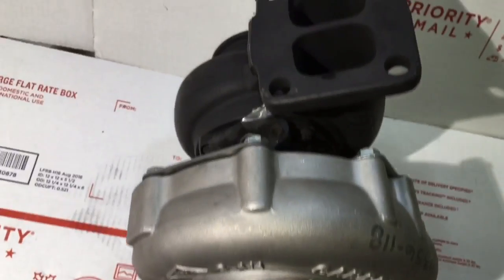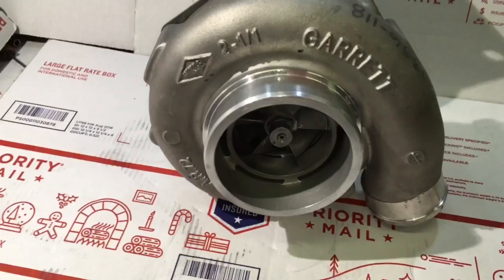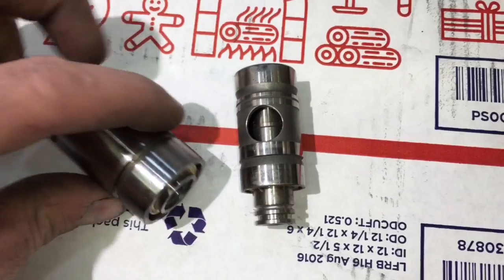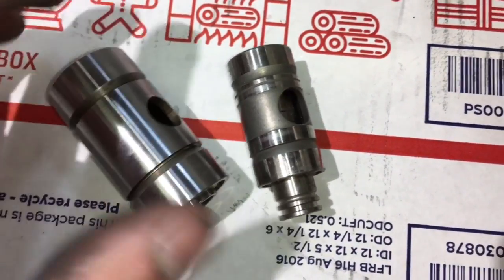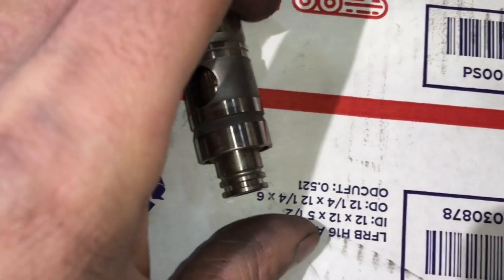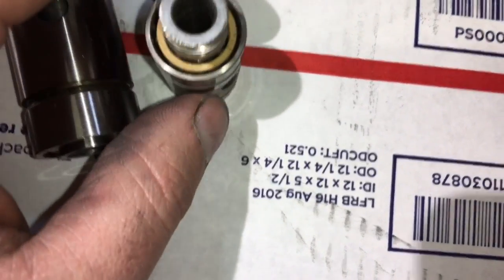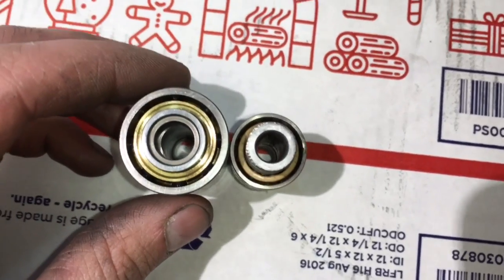This turbo comes with a much larger ball bearing cage than the GT35R series, and the thing I like about that is the cage is much more durable — it's rated past what the GT35R cage is rated at. The GT35R cage usually comes apart around 40 pounds of boost, and the most I've seen on the 35R cage is 900 horsepower, but that was really pushing it. I would not recommend trying to make over 850 horsepower on the GT35R cage.